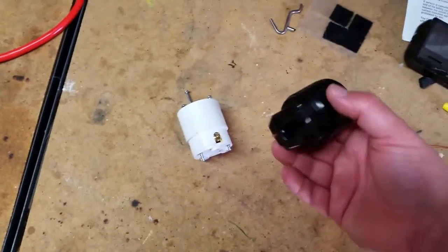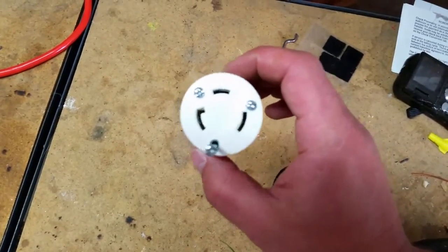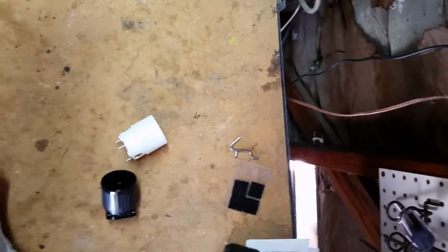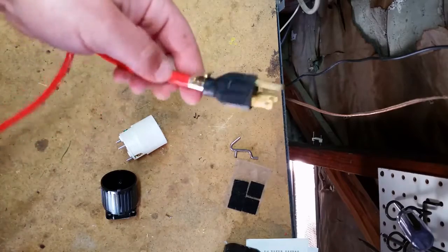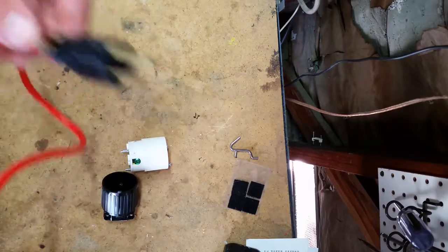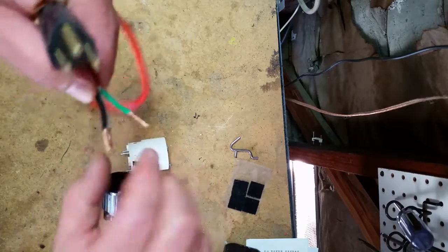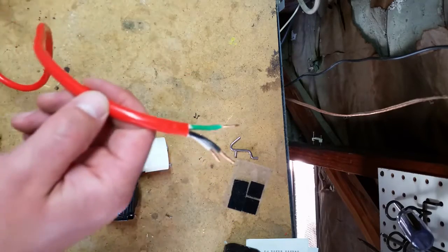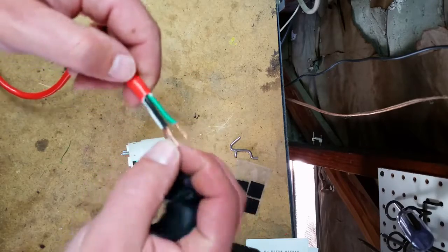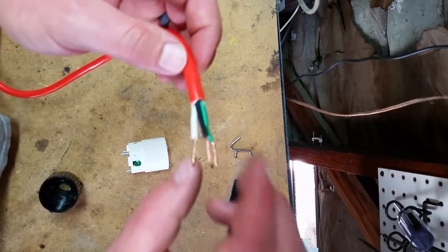Here's how it's going to look when it comes out of the package — you'll have two pieces: the rear collar and then the main portion of the plug where the wires hook in. When you go to wire it, you can make your own extension cord out of any gauge wire that will fit in this plug. I made this out of a standard 14 gauge extension cord and my intention was just to charge the batteries. So the wiring gauge on this probably wouldn't be enough to run the air conditioner or the water heater without potentially causing a fire. You have to keep that in mind when using adapters and pigtails — those go from a 30 amp plug down to a 15 amp supply, so if you try and turn everything on in your RV you could end up with a fire.